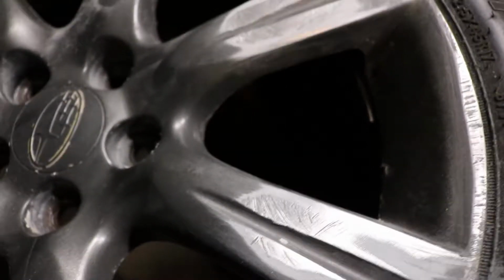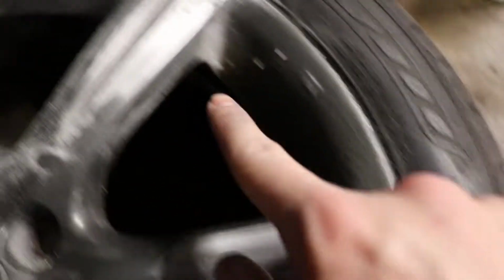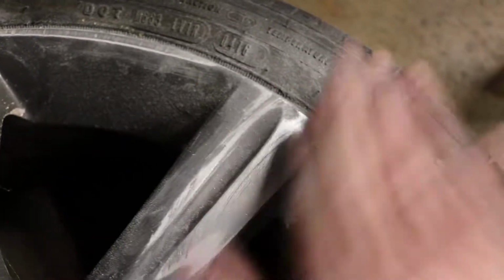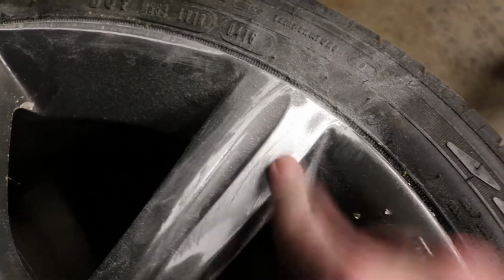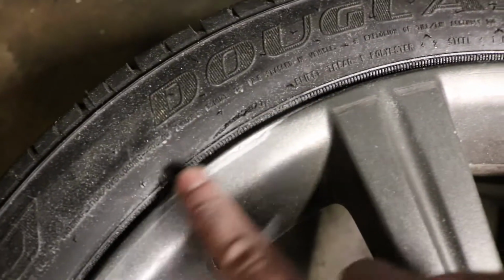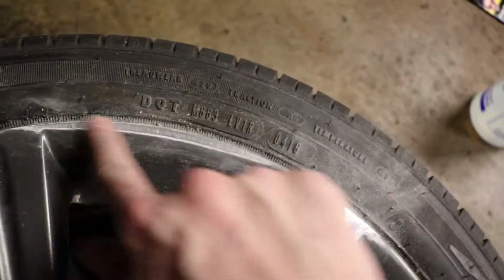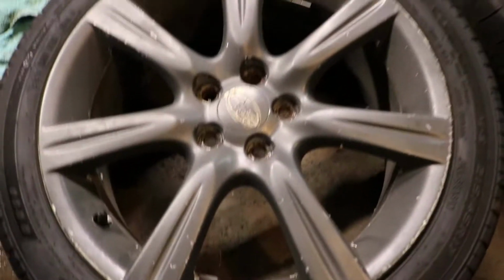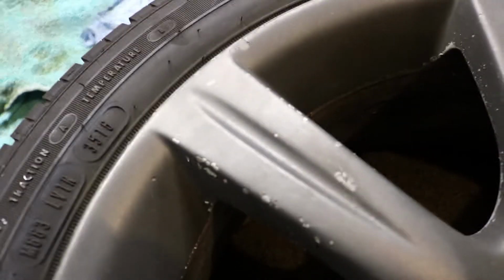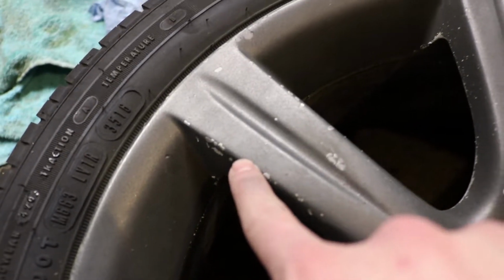If you guys wanna take a look at what I mean, these scratches really aren't that deep, and they're kind of smooth, honestly. Where this really deep one was, the one I thought was really deep, it's not even there. So I think I might just use that filler primer, and it'll fill in these little micro scratches. Up here there was a gash, but it's pretty smooth now. And here, it looks noticeable now, but I bet once I paint it, you won't even see it. For this stuff, I'm obviously gonna sand the entire wheel with a light sandpaper, that way the paint has somewhere to stick. Where this paint is chipping up, it's barely chipping. Just take a really light sandpaper, just make it look a little less noticeable.